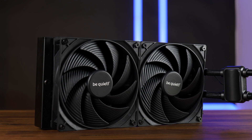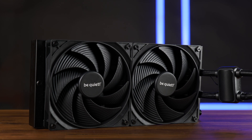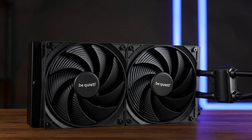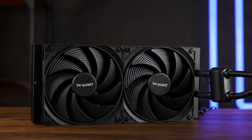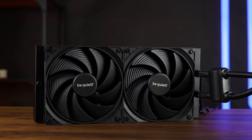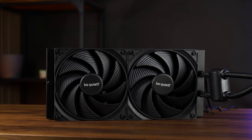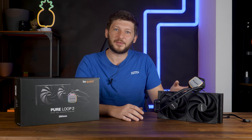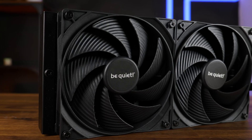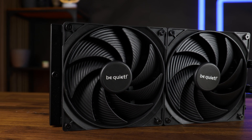So what did actually change? The fans. Compared to the FX line, we are now looking at Be Quiet's newest Pure Wings 3 in 140mm high speed — 9 heavily bent wing-designed 140mm fans spinning up to 1800 RPM over a regular 4-pin PWM connection. They've got no RGB, and they look a lot more similar to Be Quiet's current Silent Wings 4 lineup. To be exact, they look like the cheap version of that, and that makes sense — Pure Wings was always the more budget-focused line.